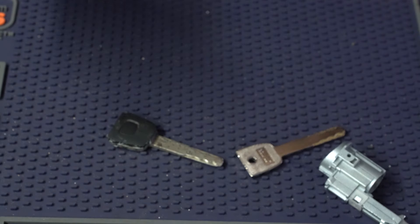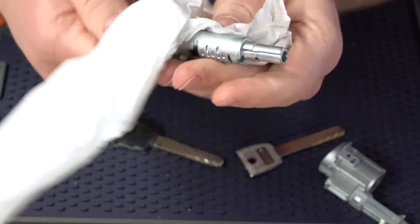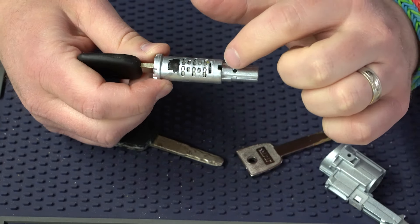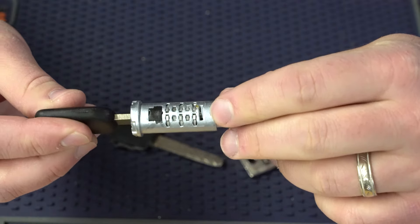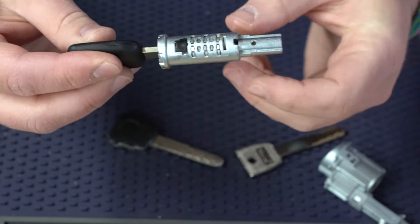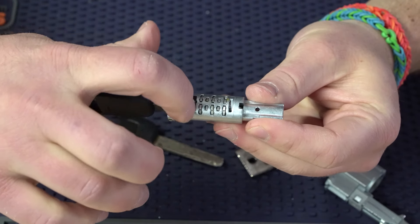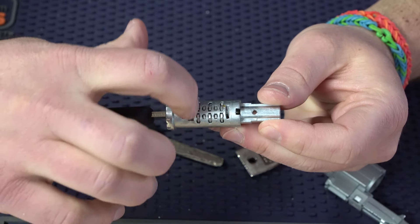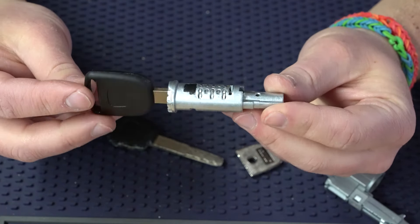I'm going to have a paper towel here and wipe off all the grease while I'm working on it — we can apply the grease at the end. Now what you see here is a whole bunch of these little wafers. They use these finger-slash-split style wafers, except at the very end there's one full wafer. The most interesting thing I've heard from a lot of different people is that even on the OEM ignitions, they're always missing wafers. I just pulled this one out and it doesn't have that full wafer at the very end. At the same time, I've heard that on OEM ignitions, these first two wafers are also missing — I've talked to guys who said they've never seen an OEM ignition with those first couple of wafers in it. I have no idea why that is, but that's what they're telling me.